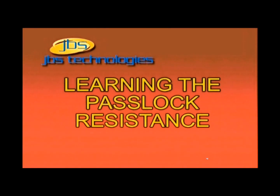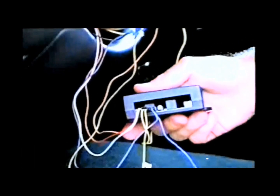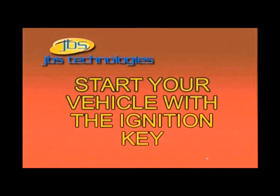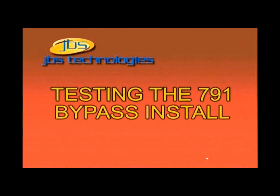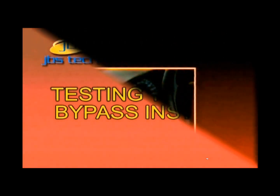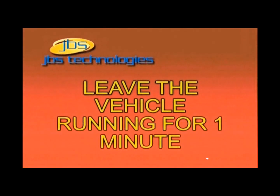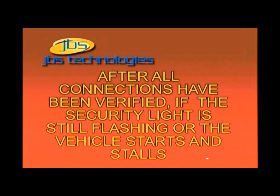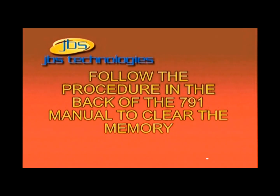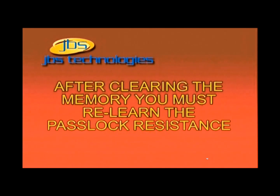Step 11: Learning the PassLock resistance. First, plug the 8-pin wire harness directly into the male header on the 791 control module. Start the vehicle with the ignition key and let it run approximately 2 minutes before shutting back off. If you have completed the remote starter portion of your install, you may now test the 791 to ensure it is working properly. Start the vehicle with the remote transmitter and let the vehicle run for at least one minute. Visually inspect the dash to ensure no security lights or anti-theft lights are flashing. If a security light is flashing, or the vehicle starts and runs and dies a few seconds later, follow the procedure in the back of the 791 manual for erasing memory. When the memory has been erased, you must relearn the PassLock resistance.